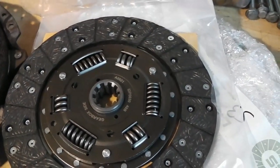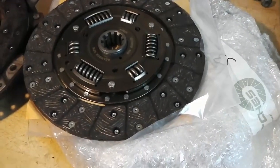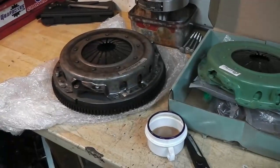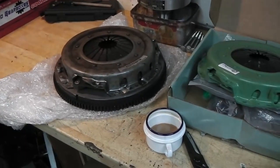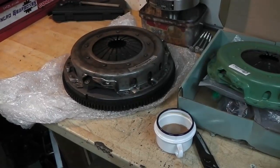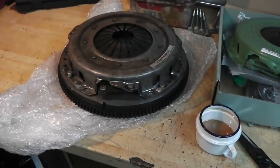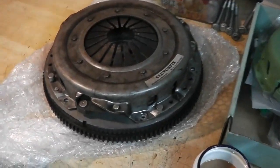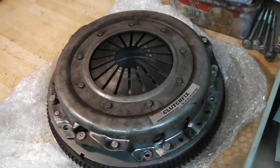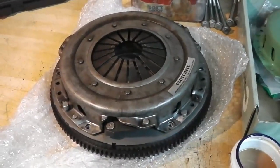Apparently the new LOF clutches are an organic material, so it'll be interesting to see if it performs any differently. The clutch spigot appears to be fine - I've checked it against the new primary shaft and the one I'm going to use for lining up the clutch; they all measure up the same and the clearance looks okay, so I'm happy with that. Nice to be able to leave that alone as they're a bit of a sod to get out if they don't come easily. Just trying the Series 3 clutch on the 2.5 flywheel - it fits perfectly, so that's useful to know.